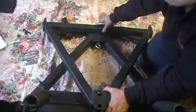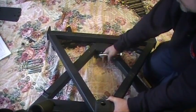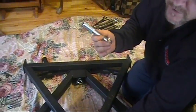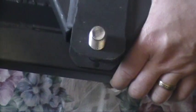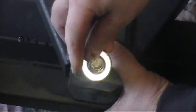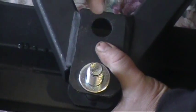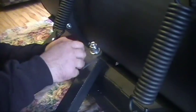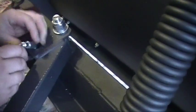I've got the frame laid on top of this with the notch groove inside the groove we showed you with the block in it. I'll take this bolt — it has a flat washer on it. It's a very large bolt, the only one like this in the kit — you can't miss it. It's going to go underneath through this assembly like so. It's going to hold everything in place. The washer goes on top, and once again another lock nut on top of that, and we're going to tighten that all together. That's our basic frame assembly. Take this apart, hook your cable on, screw it back together and it'll work great.